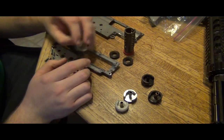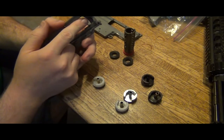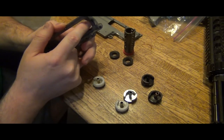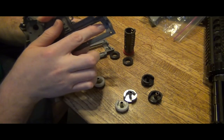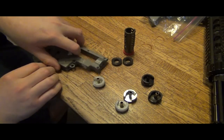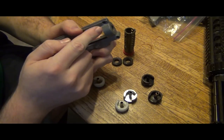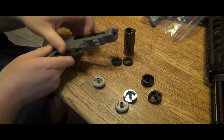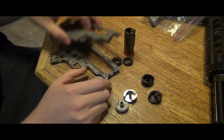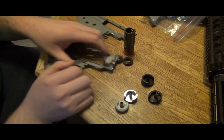So my thought is the impact is between this mound and this mound — therefore it's closer to this section. So even if you were to radius this and have a better material, you could still get cracking if your cylinder head was not actually pressing towards the front.